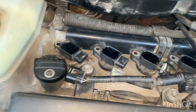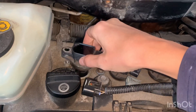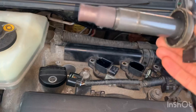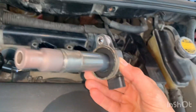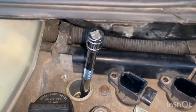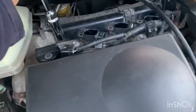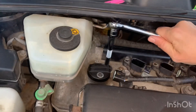I took the screws off, so now I have to pull these coil packs out slowly. Pulled out one — I'm going to replace one at a time. I have a magnetic socket to catch the spark plug, and now I'm going to unscrew it with a breaker bar.